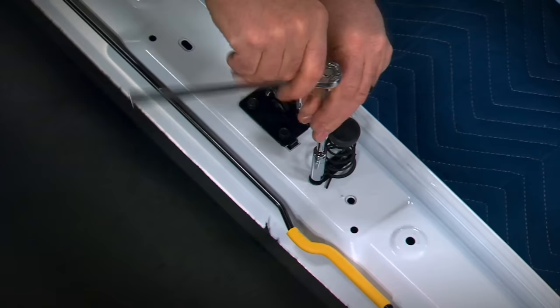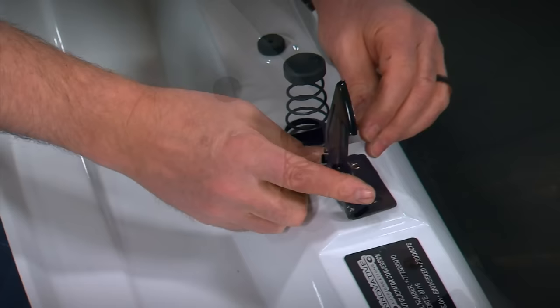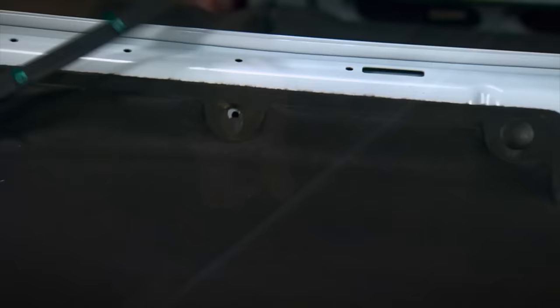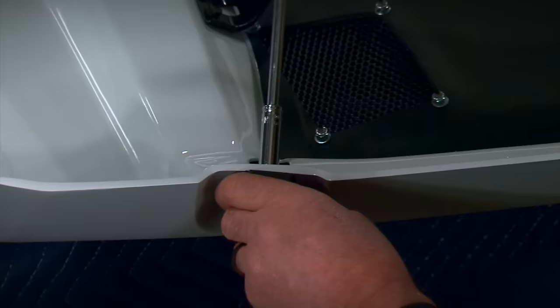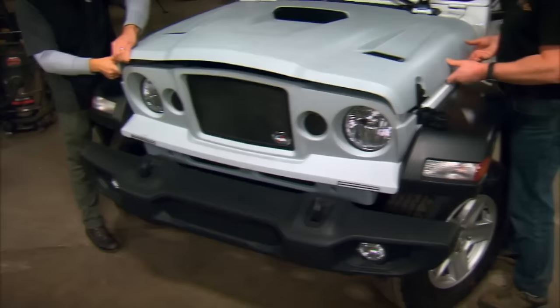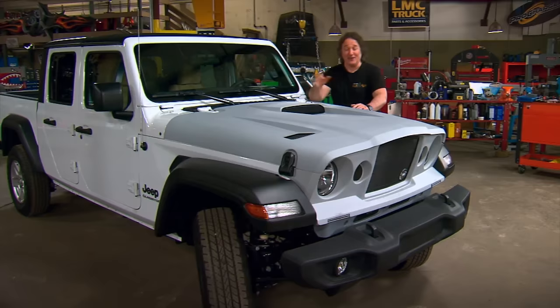The hood is even easier — all you have to do is transfer the latches, weather stripping, and hardware to the new hood. Notice that threaded metal inserts are used for strength in the hinge and any other high-stress areas. Now it's just a matter of holding it on. You've got to admit, this is a huge difference and a huge improvement over that stock grille and hood. Once everything is pre-fit, it just takes a little bit of light sanding and you'll be ready to paint, and the transformation will be complete.